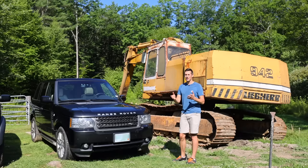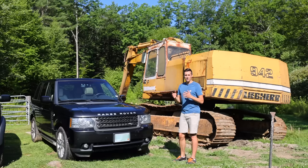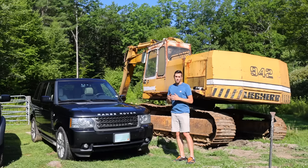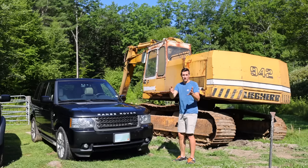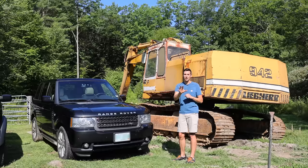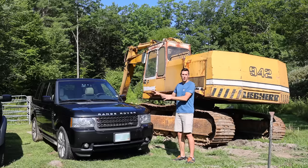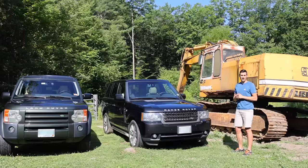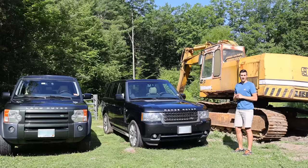It's the same issue with any donor engine — whether it's an LS or maybe a 5.7-liter V8 from a Toyota. Wouldn't that be the most reliable Range Rover ever? I'd need to reverse engineer how everything works on the CAN bus from the donor vehicle and build a translation layer between the engine and the rest of the vehicle. But maybe you can help — if you work for Jaguar Land Rover and have access to that proprietary CAN bus message data format and send it to me, that would make my life so much easier and I assure your confidentiality. If I don't do a custom engine swap, I'll likely just buy another Range Rover totaled with a working engine and do a straight engine swap — that's probably the cheapest way to get this thing going. The lesson from this video series: don't buy a cheap Range Rover unless you have plenty of time and money to throw at it.